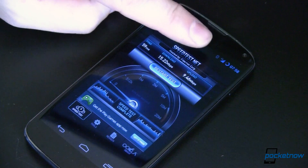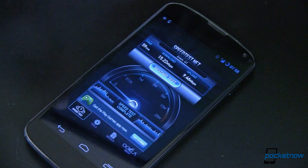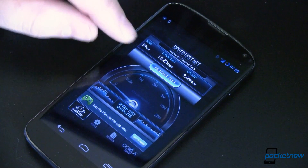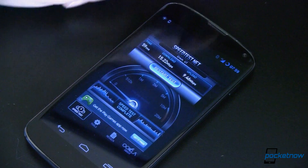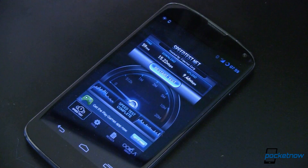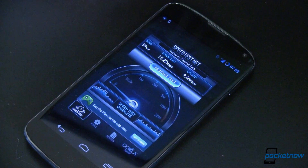One other thing: battery life on LTE — I always thought it was going to be hideous, but it's actually better than HSPA in my experience. If you're not getting these kinds of speeds, try again at an off-peak time of day, and if you're still not getting them, try flashing the other radio. This one is .33-84; try the .27-84 and see if it performs better for you. Use whichever performs best.